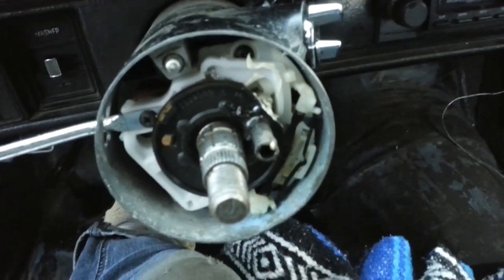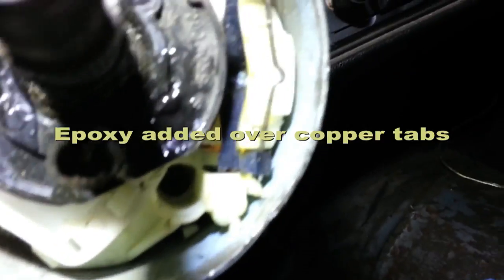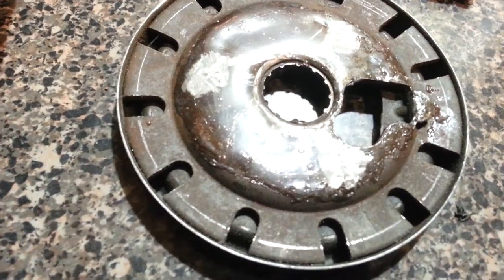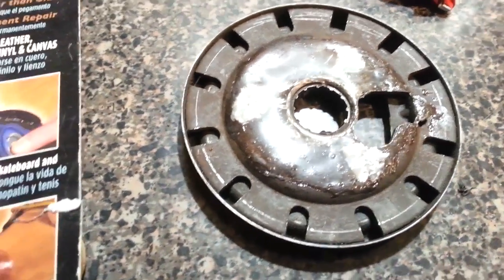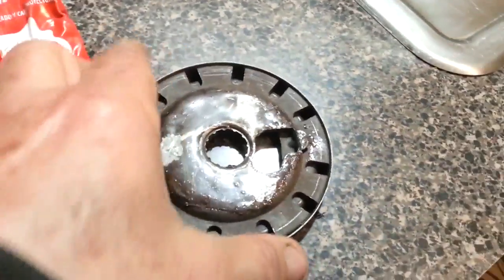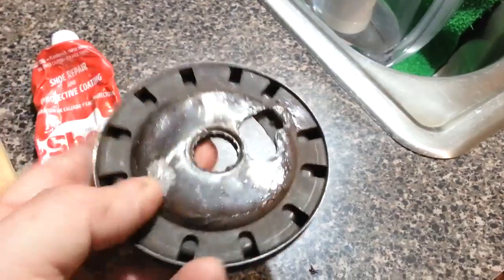I think that's going to work out alright. The bolts protruding through the locking mechanism have been ground down so they can't contact the electrical connection tabs underneath the steering column. And I used something called Shoe Goo to insulate this very hard — actually that's pretty good, not just for shoes.